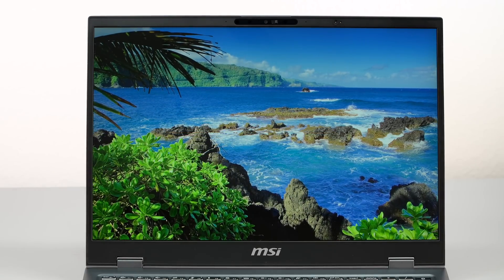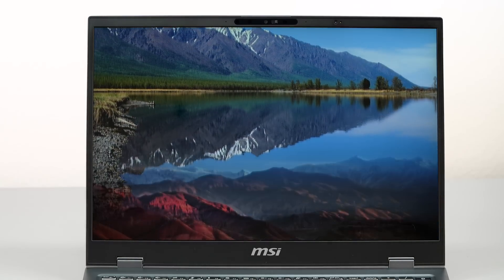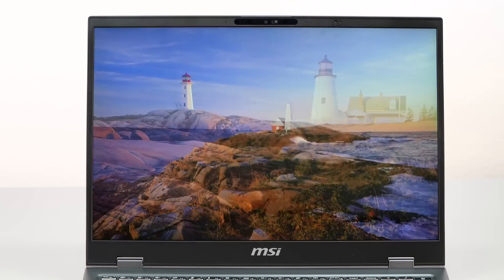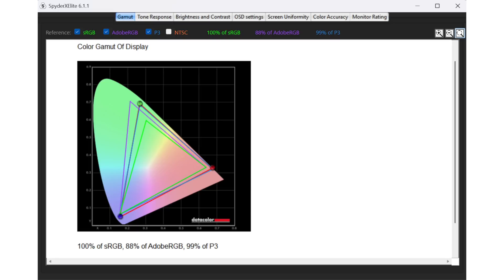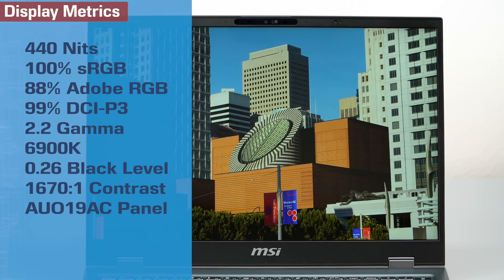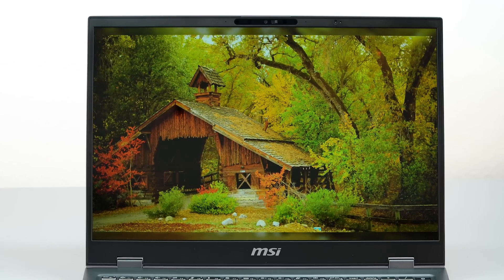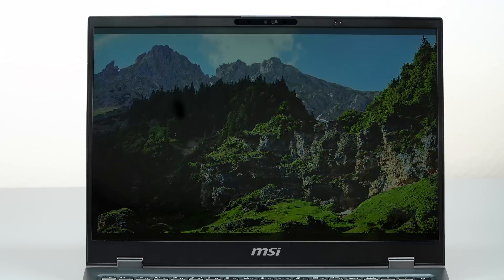Let's talk about that super shiny display. They have outdone HP Specters — oh my God, this thing is reflective. It's annoying. Stop it, MSI. Anyway, it's a QHD IPS 2K 16:10 aspect ratio display, so 2560 by 1600 resolution at 60 Hz refresh rate. That's okay for the kind of laptop this is. It would be nice to have 120 Hz — a lot of competitors offer that these days, hint hint. It's got full P3 color gamut, though it doesn't quite hit Adobe RGB. It looks nice and it's 440 nits, which is enough to largely overcome the incredible reflectivity indoors, but it's too reflective to use outdoors. Looking at their specs page, there appears to be a 4K OLED option coming, which will also be super glossy and non-touch — again a shame, but could amp up display quality nicely for photo editing or watching 4K video.